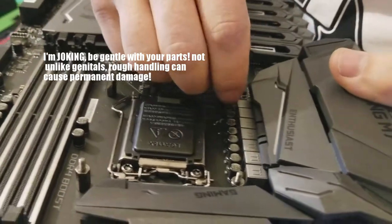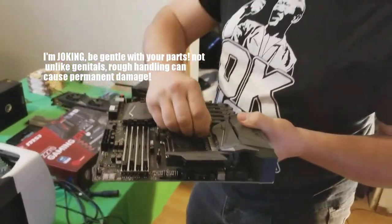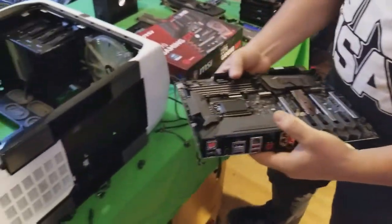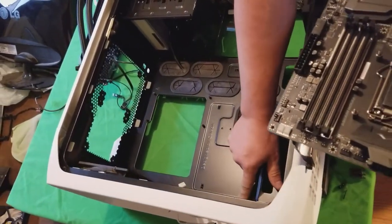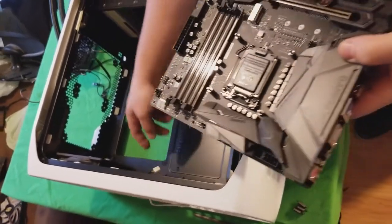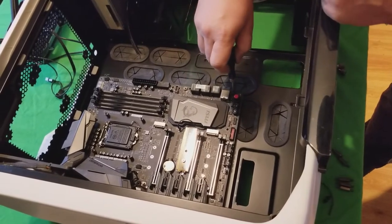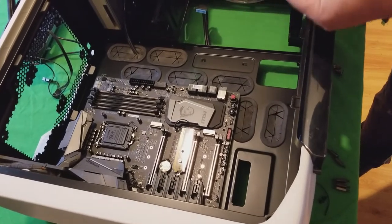Always remember when dealing with computers you want to just jam things in there. Now what you want to do is toss the motherboard in there — I already put the standoffs in as you can see. This is where your motherboard is going to sit. Always put the back plate in first before you put it on your motherboard, otherwise you have to take everything back off. Then what you do is place the screws in and turn them clockwise — lefty loosey, righty tighty of course.